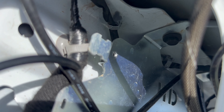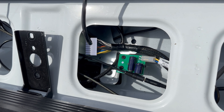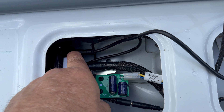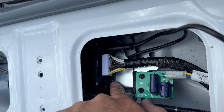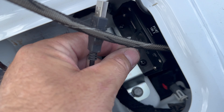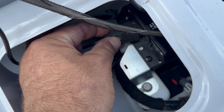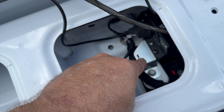It's pretty simple — just slide it right in there. You have to put the mounting plate in first before you put in the amplifier. Insert the amplifier from this direction here, then go over and screw the wire in. Don't put this wire on until you put the two screws in, because one of the screws is right underneath there. There are two screws on each side — bolt all four of those down, then plug this wire in. It comes with a zip tie to secure that right there. The plate goes in first, then the amplifier.